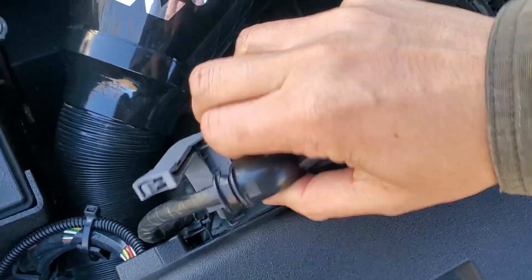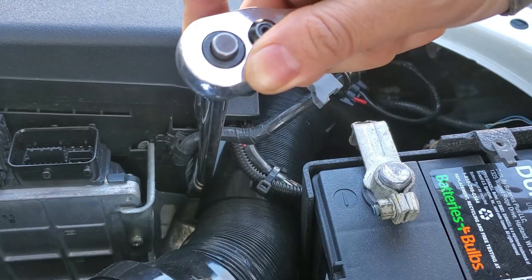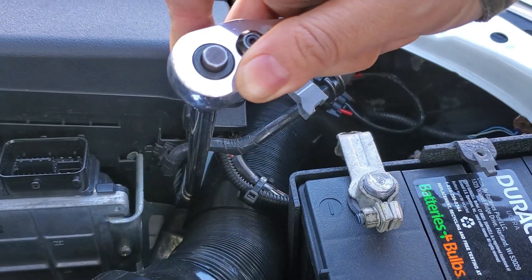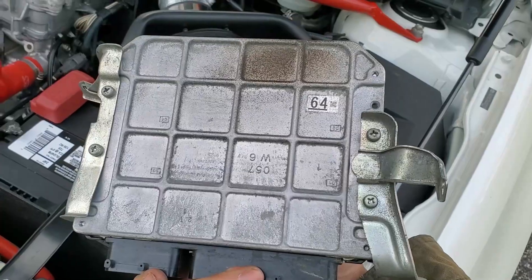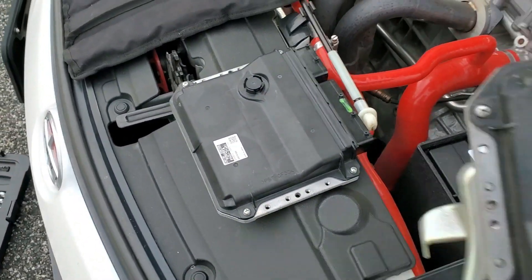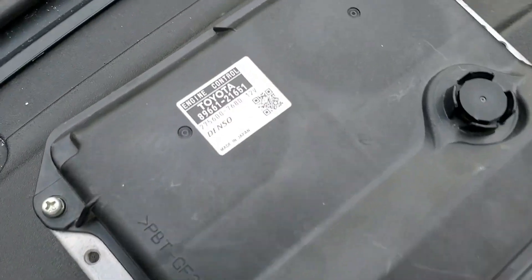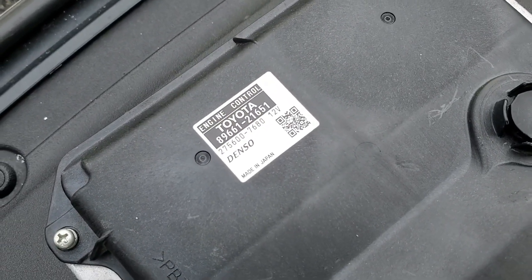The plug was being a little stubborn, but there we go. I was able to use a 10mm socket with an extension to access the lower bolt without disassembling my air intake. The ECU lifted up and out easily. Now to visually confirm the part numbers match up — 21651 and 21651. Perfect.